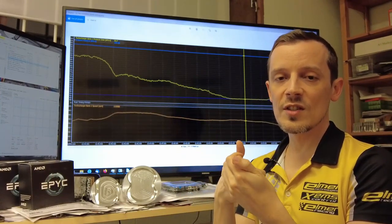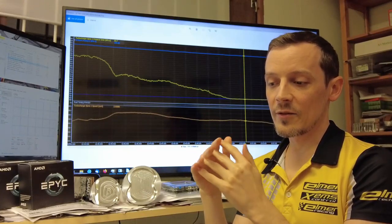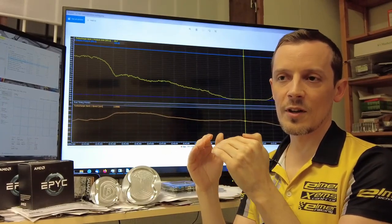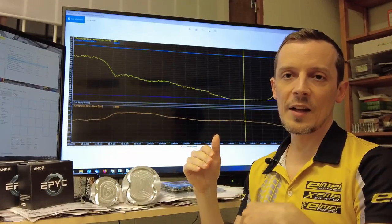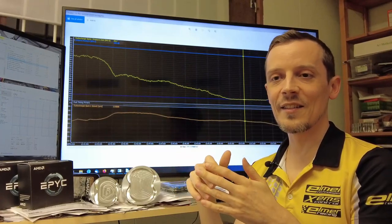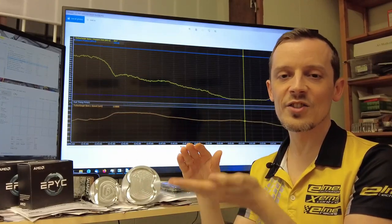Efficiency-wise, you want the highest compression ratio possible, as this gives you a higher expansion ratio. Naively thinking about the situation: this allows a lower exhaust gas temperature the more you can expand the gases in the cylinder, meaning less wasted exhaust gas heat. You're losing less energy out the exhaust, so more energy is going into the piston.